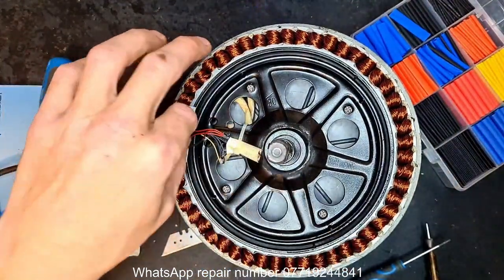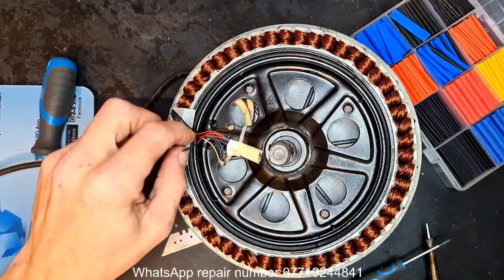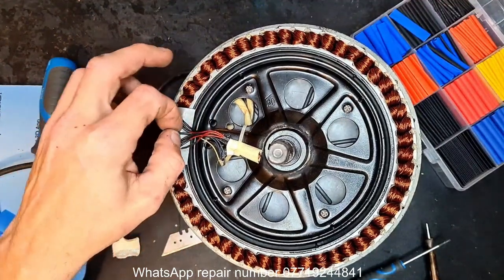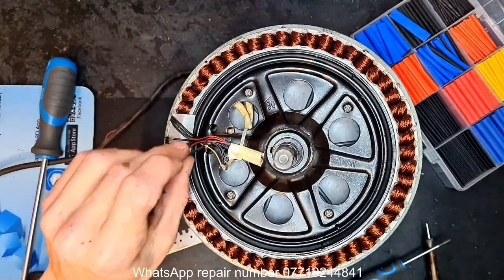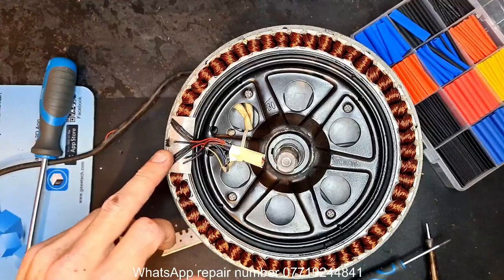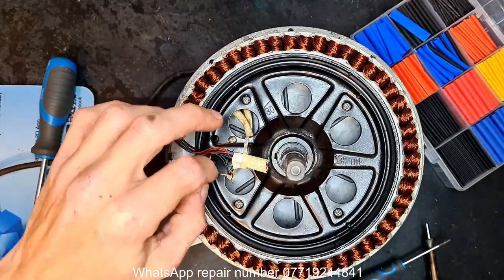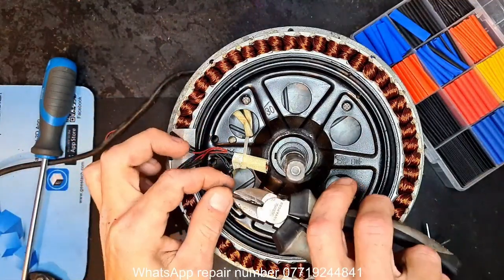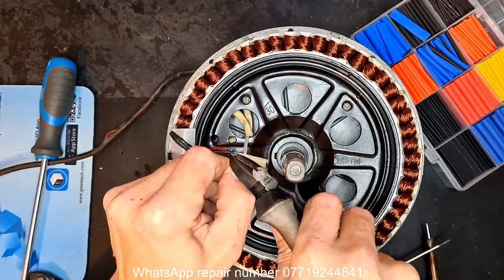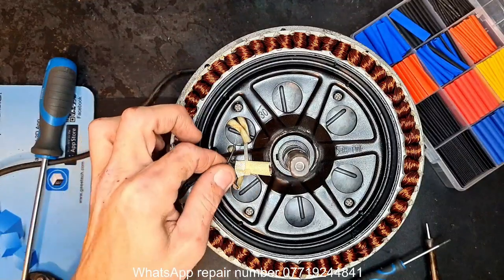We got one. We got our plus, or our VCC, whatever you want to call it. If it's coming from the controller and you've actually seen the markings on the controller board, it's marked as VCC. We've got our ground on the board, it's marked as GND. This is just in case you ever want to run a manual cable. I've done that a few times. And our yellow is over here. So let's just start trimming these up a bit. See what's under them. Okay, that's a nice pin.